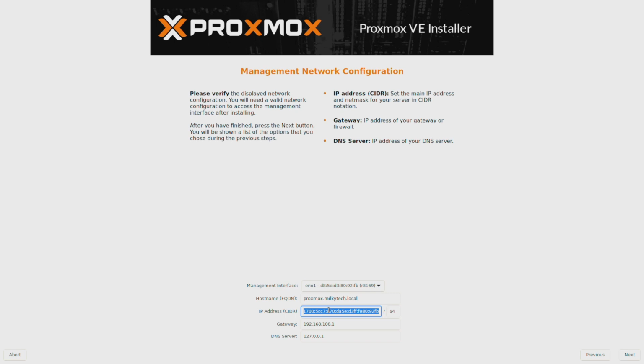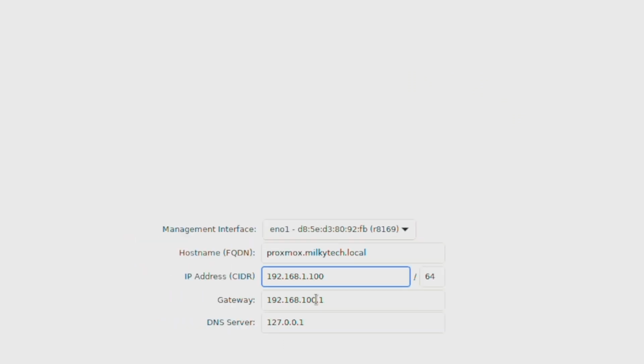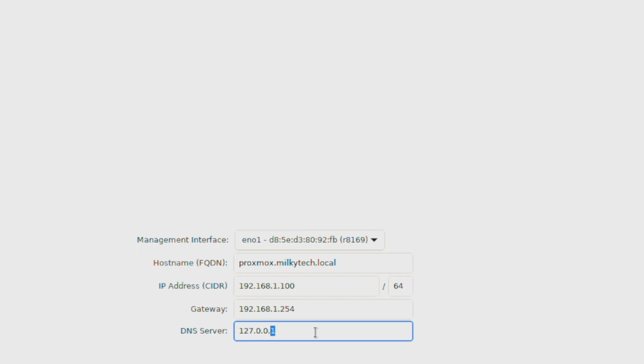Maybe it's because I have too many devices on the network, so it can't detect the right one. So that's why we took a picture of the IP config information, and now let's plug it in. For some reason, I thought it would be cool to have an IPv6. Let's just put the easier IPv4 address in. The next thing that we want to change is the gateway and DNS server IP address. These addresses need to match the address that's on my PC. So let's fix that really quick.